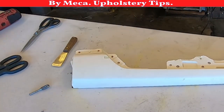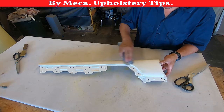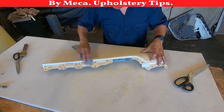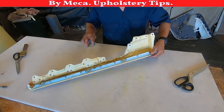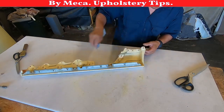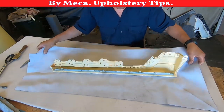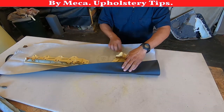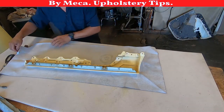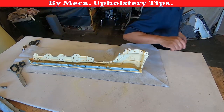I got the foam out. Now I'm going to sand it a little bit — not that much. I'm sanding it because I'm going to put a lot of glue in there. Make sure to put a lot of glue because you don't want that part to come undone later. When you don't put enough glue and that part is exposed to the sun or the heat, the glue comes undone and you don't want that to happen. This vinyl doesn't need to stretch on all four sides — it only stretches one side — so on this part you don't need the vinyl to stretch that much.